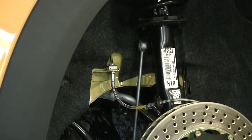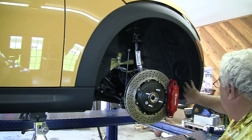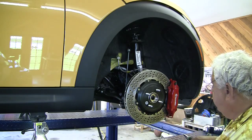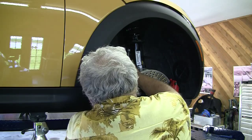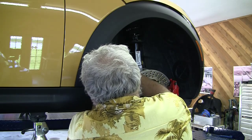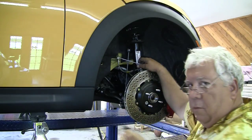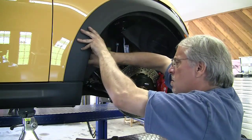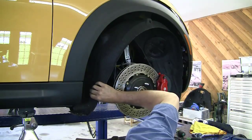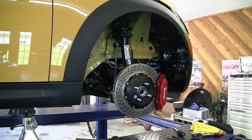So we can put our wheels back on. There's a fabric liner inside the wheel well that we're going to have to pull to get access to some things to remove this front clip. There's a series of these little plastic retainers - screw them a few turns and then pry the whole thing out. Alright, that removes the liner.